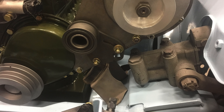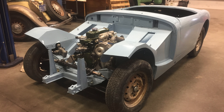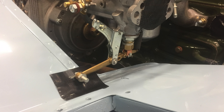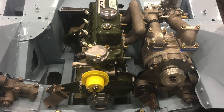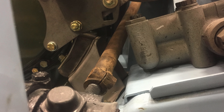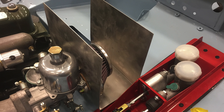As far as we know, nobody had put this setup into a left-hand drive car, and we didn't know if there would be clearance for the steering rack. So we just had to throw it in the car, start setting up the steering, and see if we could make it fit. Here you can see the steering coming down right underneath the supercharger — we just happen to have just enough room to make that work.